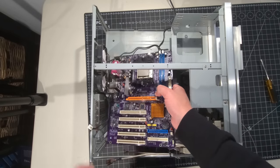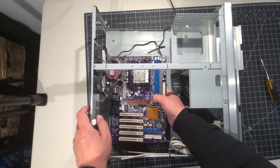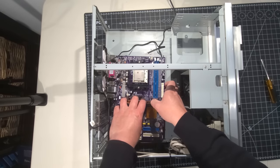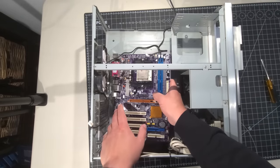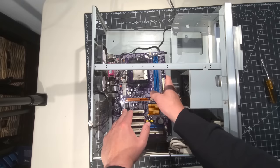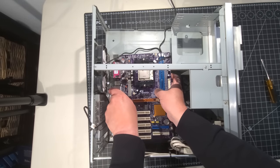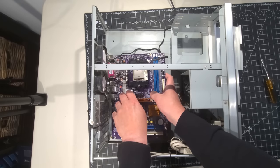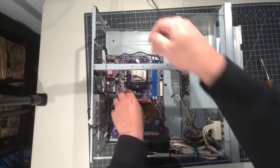Because I'm going to change the processor out afterwards, if that's what we're going to try to do. I want to make sure that I get the BIOS update first before I start messing around with the processor, because it clearly does not support it based on the information I read. I know that's semi-contradicting what I said earlier, but I just want to be absolutely sure we're in a good spot and we're not running into any problems because of a processor that's sitting inside there.